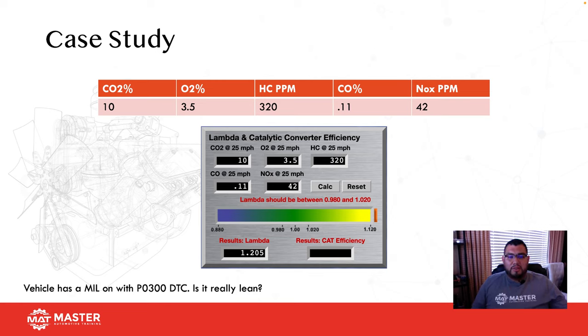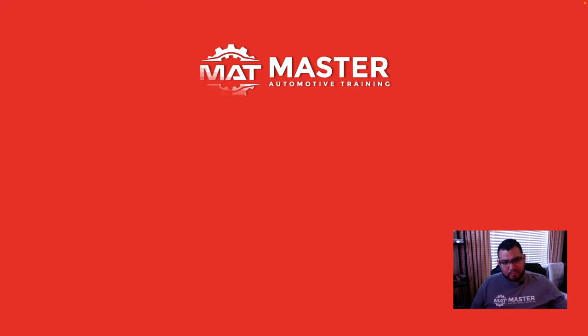So this vehicle here is not really having a lean condition. It's just that since we're not burning the air fuel mixture, this is why O2 went up, CO2 dropped, and HCs went up, because it's not being consumed, so it's going right out the tailpipe the same way it went in. So this is why we're getting what's called a false lean condition. This is why it's important to understand, is this really the cause of the problem, or is this an effect of the actual problem? Okay.